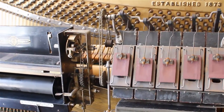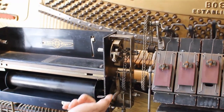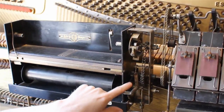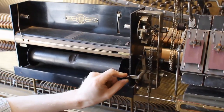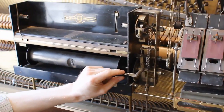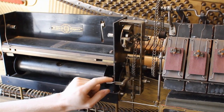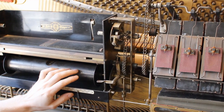Here you can see it's connected to a chain, and the chain is connected to what I would call the master cam. That is attached to a lever here, and here you can see downward in the play position, it's attached to this large disc or large gear, which basically powers what's called the take-up spool. So that's play.